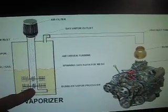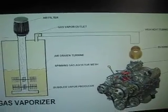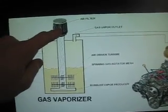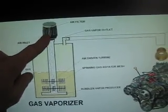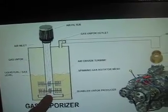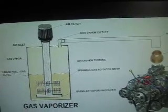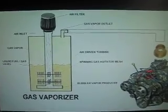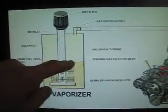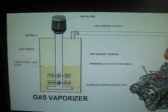When you have a hose going down through the gasoline connected to an air intake, the engine has to suck air from somewhere, so it sucks down through the tube that's going into the gasoline — a tube extended to outside air that's submerged in the gasoline. What that does is suck air up through the gasoline, which agitates the gas big time and creates a cold gas vapor, which is then sucked up through the tube into the engine. That's how it works.